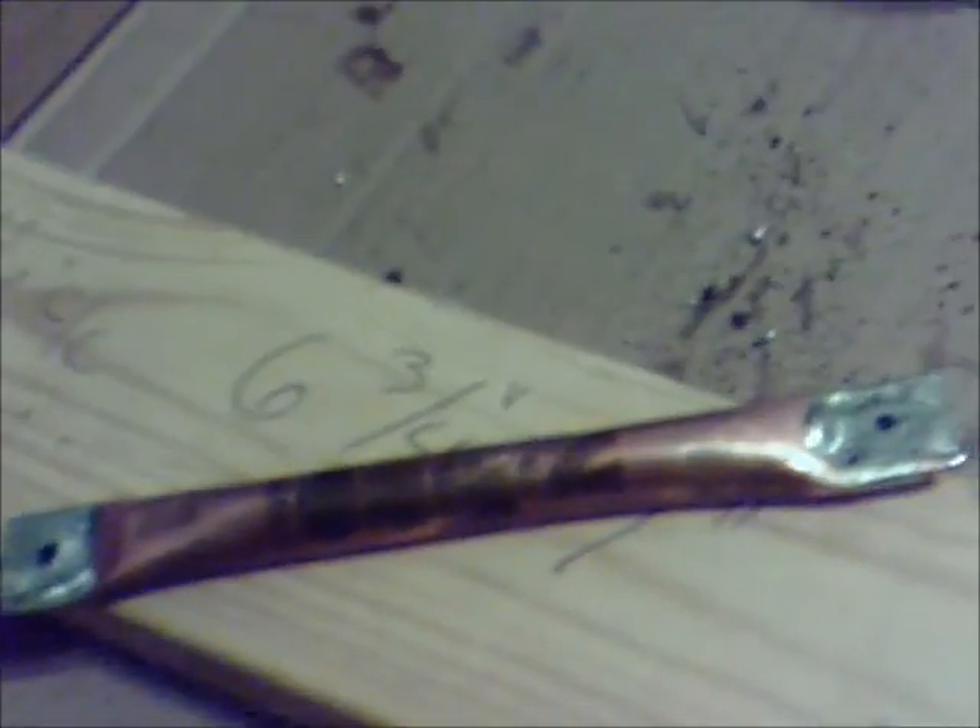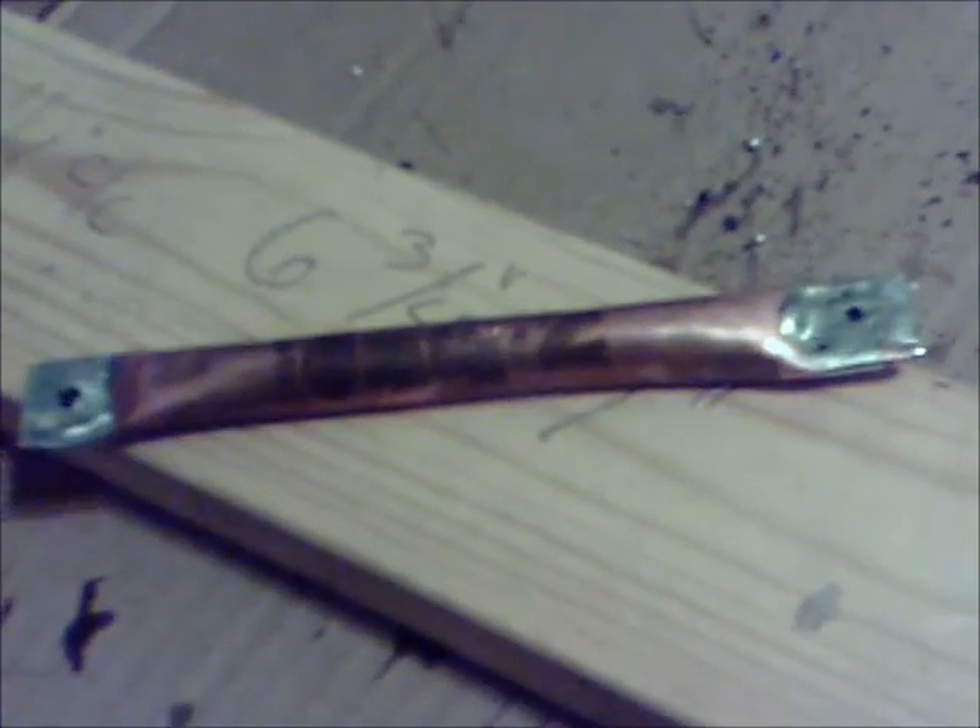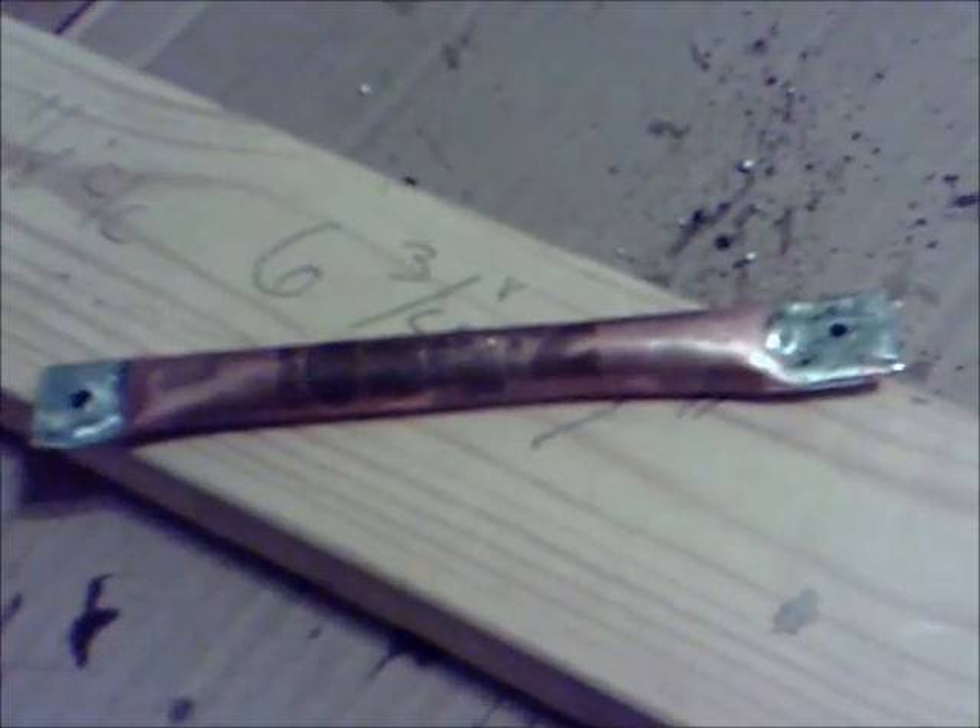Those are where I'm going to drill holes. Start out drilling with a smaller bit because it's soft metal — starting out with a 1/8" bit, and then I'll progress up to 11/32", which is just a little bigger than a 5/16" stud which is on the battery post. We're going to drill this out, both ends, and we'll cut to being out there where the batteries are at.